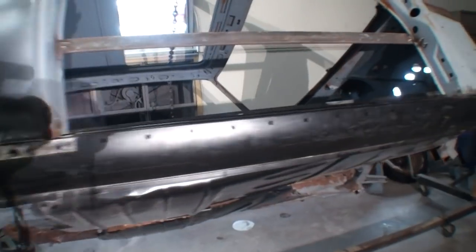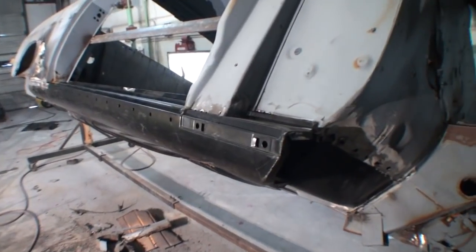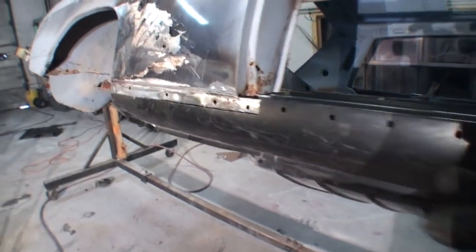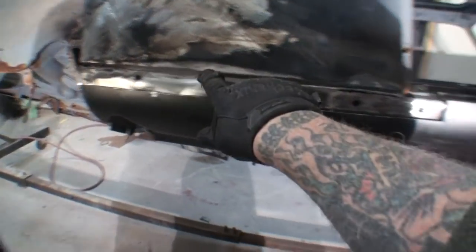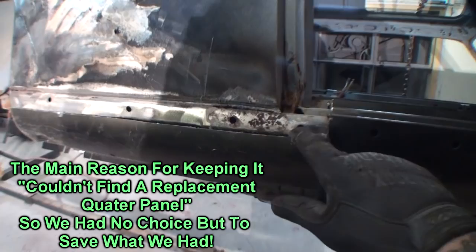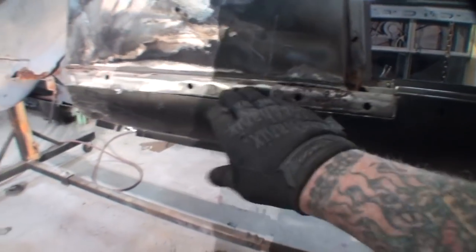So back to this nightmare. You can see that the Mercedes-Benz parts really, really fit good. Here's where our spot welds were originally, and when I push this thing up and get it in place, it's all going to line up really nice and give us an accurate fit. Now, what I did over here — being that this quarter panel is good — you can see where somebody patched it right here. We don't want to disrupt this factory seam, so I'm keeping part of the original rocker panel and then I will graft this piece in, and we're probably going to butt weld that.